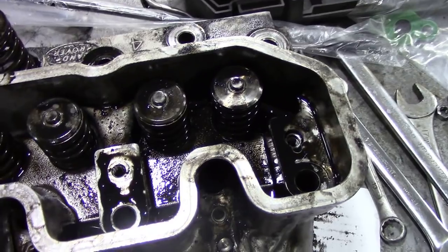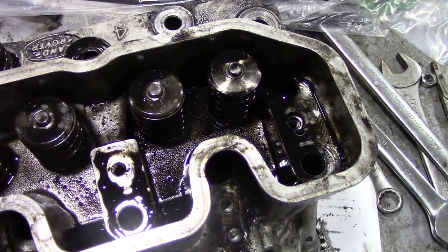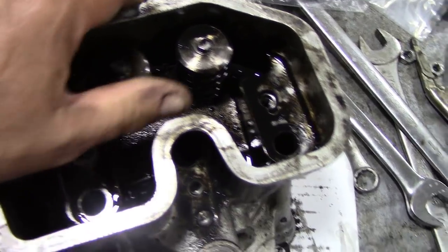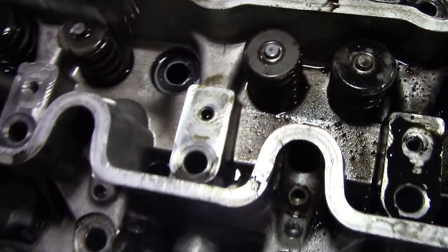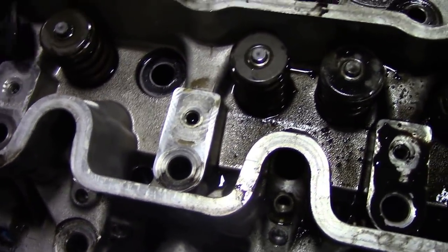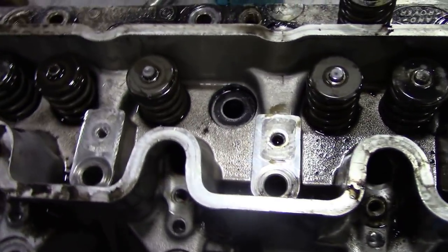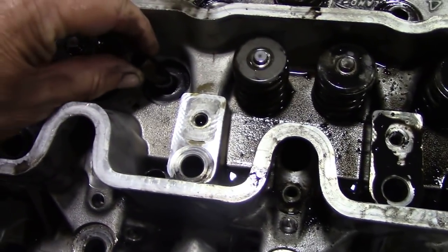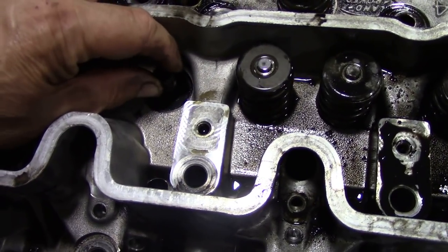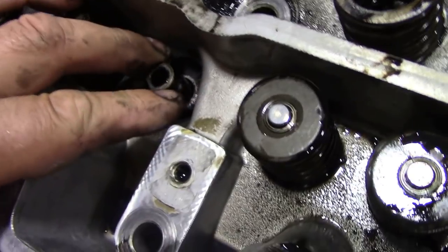After a while the diesel in the cylinders didn't go down, so it had to be something else. I did the old trick and had a look at the valves to see how tight they are. When I got to the exhaust valve for number three, it was rocking around like a drunken sailor. The guide is so loose — it's worn in the head so much. Look at that — the head's worn out.